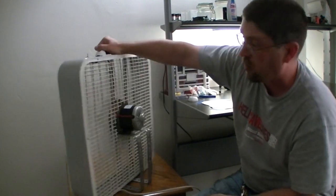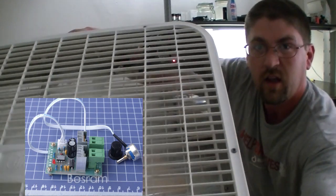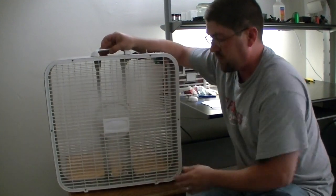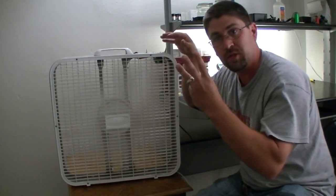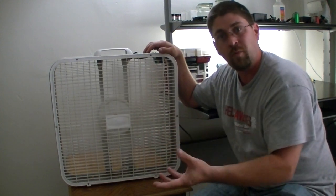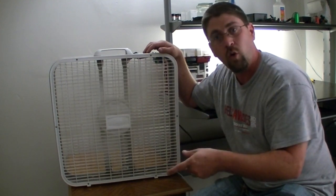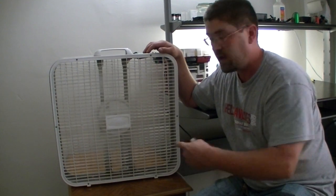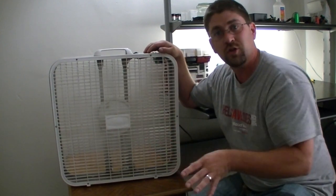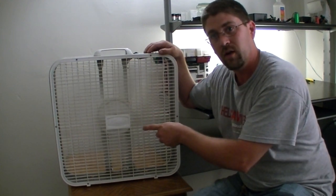The third thing is you're going to need a DC PWM motor controller. The reason is that the way you get three different speeds on an AC fan is there are two separate coils inside the AC motor — a smaller coil and a bigger coil. Low speed energizes the small coil, medium energizes the big coil, and high speed energizes both. And interestingly, the DC motor is more efficient and uses less power than the AC one.